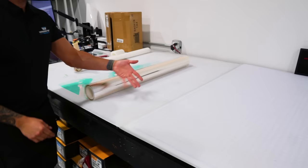Looks good. Make sure there's no extra tension in the center. Start squeegeeing from the center out. Gonna have to shrink a couple of those fingers. Not a big deal. Or they might just stick. The whole key is to not just squeegee across the bottom or squeegee across the top, but you want to gradually work the entire panel over to the side. That'll stretch the fingers out and make them nice and even, and much easier to lay out.